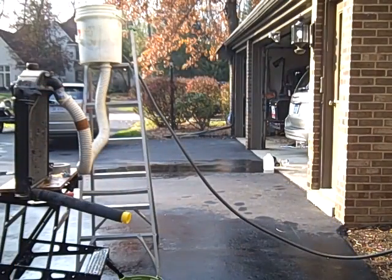In order to get the right gallons per minute, the radiator has to flow full the entire time. My hose doesn't put out enough water to do that, so we have a five gallon bucket up on our ladder with a flap valve in it. We fill up the bucket, keep the hose running in it, pull the flap valve, pull the plug from the bottom while the radiator is flowing full, put a bucket under it, and hit a stopwatch. We know how much water came through and how long it took, so we can calculate the gallons per minute. It looks like a Rube Goldberg setup — and it is — but it works.